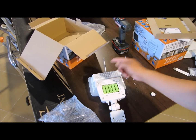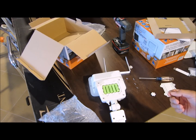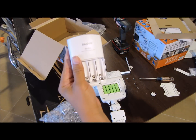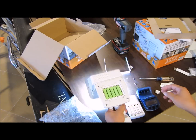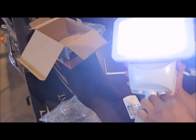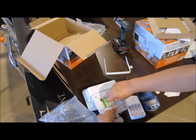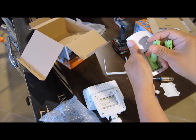You've got five rechargeable batteries in there. What I would do initially is charge them. The manual says to turn off the fixture and let it charge for two days, but if you have a battery charger — like the Sanyo charger or the LaCrosse that you can get at Costco — those will actually work. So what I would do is take the batteries out and just charge them. They'll probably take about three to six hours to charge.